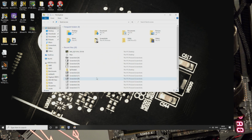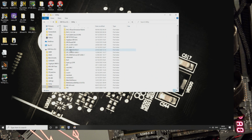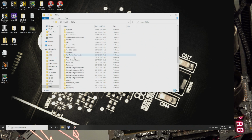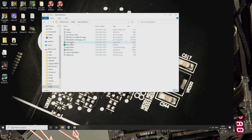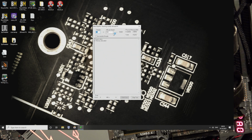And let's pull up memtest, because I wonder how bad this is in terms of stability. This could be anywhere between instantly spewing a million errors a second to... actually, it probably can't be that unstable because it ran both Geekbench and TimeSpy, but where is memtest? Oh. No. We need the deluxe version, which is better, mostly because it doesn't need to spawn a bajillion windows. We're going to want to test 900 megabytes? Yeah. So that'll use like 14.4 gigabytes of memory. Hey, it's not immediately spewing out errors everywhere.